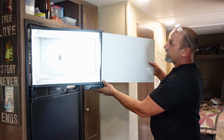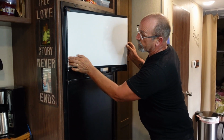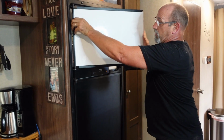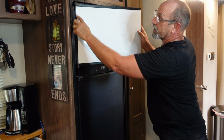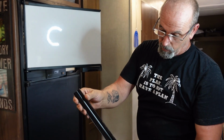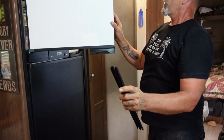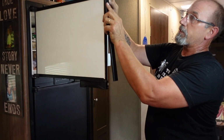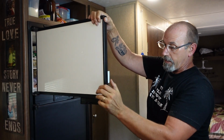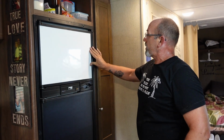So I've got it set there, and now I'm going to go ahead and insert it, a little stiff. We're going to get to the end right over here, and I'm going to make sure that it's all the way in the channel back there. Give it a couple little love taps. Now we take this channel, and if you notice, there's a thick side and a thin side, or a wide and narrow. The narrow goes on the paneling side, and the wide goes towards the inside of the freezer. So go ahead and set it in place, start tapping it down. It's all the way in. We've got it completely in. It's not going to move around. There we are.